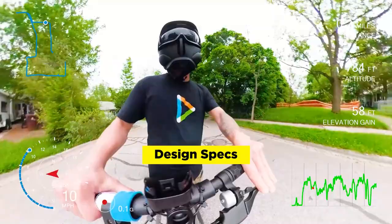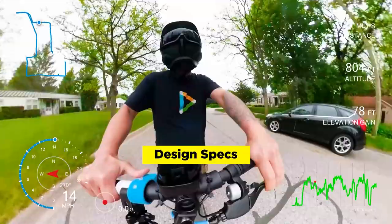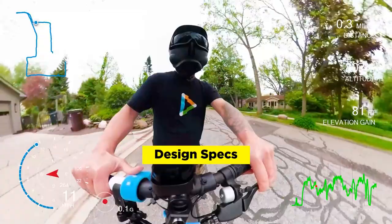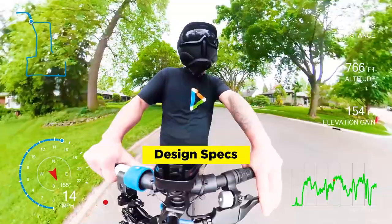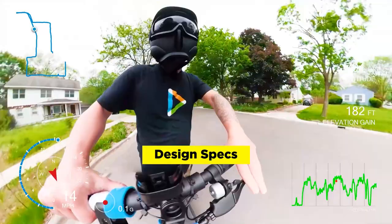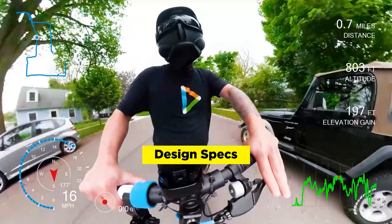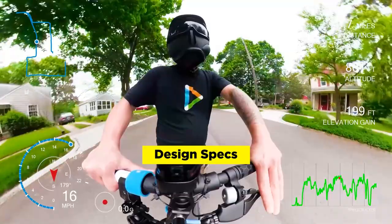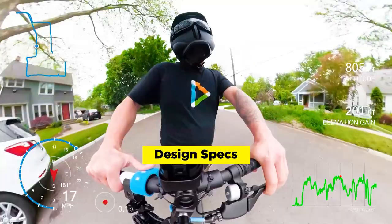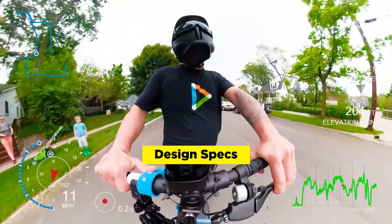So I don't know if I actually want to ride this thing through water, but in case you get stuck in rain or something, it is waterproof. This does come equipped with a 36-volt Panasonic lithium-ion battery that comes in a tube, and that tube actually fits inside the handlebar stem. That means the stem is actually really thick, but the weight distribution may be a little bit better. As for the hub motor, it is a 350-watt hub motor up front that is kind of zippy. On the hub motor are 8.5-inch pneumatic tubeless tires. The tubeless tires have better traction on the ground, and if you do get a puncture, you can actually seal it without having to remove the tire from the scooter — that's one of the benefits of the tubeless design.